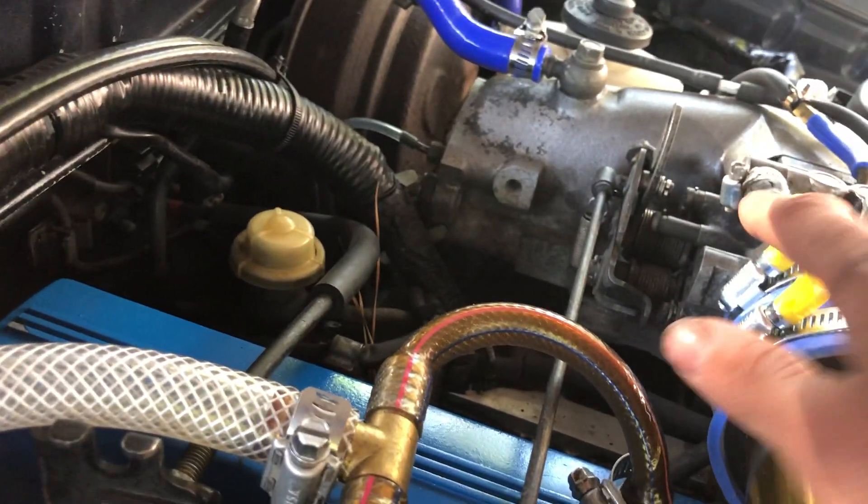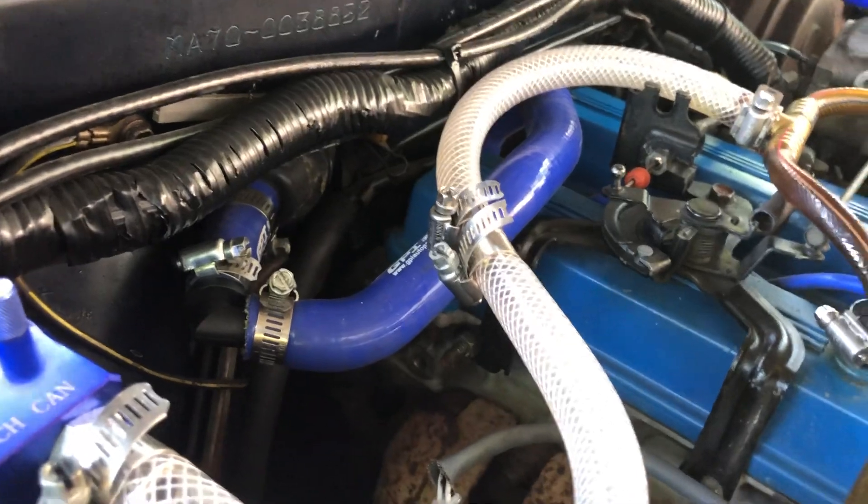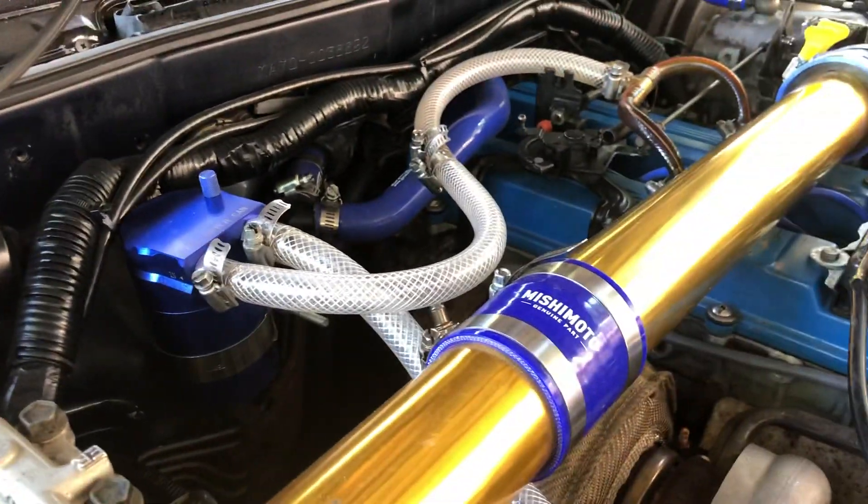But I eliminated it going right into the intake, and here's why: upon startup it was giving me a whole bunch of oil output, and the stock pipes and intercooler pipes I had were full of oil — just laying in there, thick and goopy and disgusting. After I put this catch can on and ran it for a while, there's not even a drop of oil in these pipes.